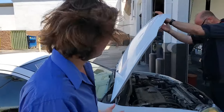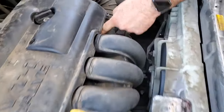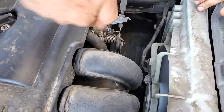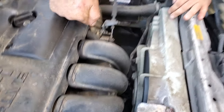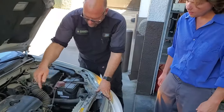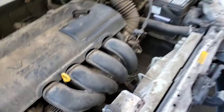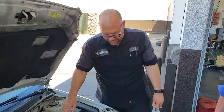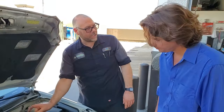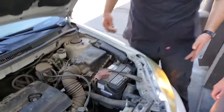We're going to start getting inside - inside the engine - and we're going to take out some stuff. We're going to go in through the evap line, which is the furthest forward on the throttle body. If I go in there, I can make sure I get good foam disbursement through all the cylinders, because if you pick anything further, it might just go into one runner. I have to do it that way because I have a mass airflow sensor, and if I do the throttle body trick, it's going to stall because it's not getting a mass airflow reading. So I just skin the cat a different way.